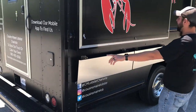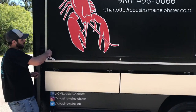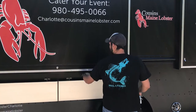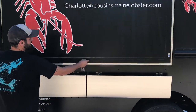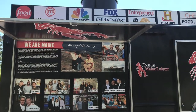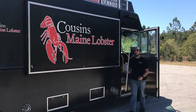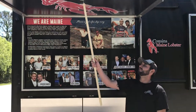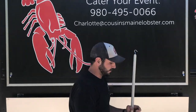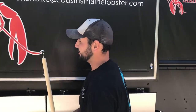To open your awnings, we have three locks — two that require a key and one that is a spin lock. We're going to use that silver CH751 key. Make sure it's unlocked in the middle. When you put these awnings down, always grab from the very middle of the awning. We don't want to grab on each corner because we do not want the awning to break over time. We have a hook that we make for you — put that on the handle and close it down. Before you ever get into transit, make sure these awnings are closed and lock all three locks as a precautionary measure so we're not having to replace an awning.